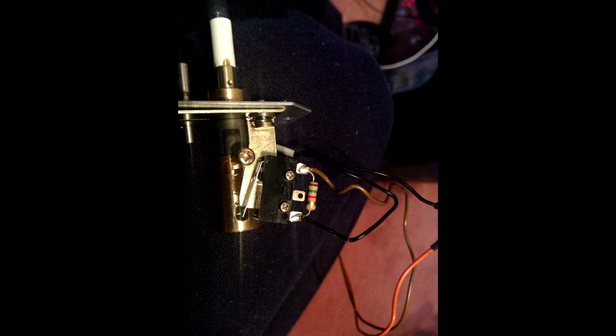Just at the top of the switch you'll see where the black cables are — there's some grey plastic around the cable. This is because there's a small hole where the wires feed through. When you're feeding the new wires through, be very careful that you don't start stripping the plastic casing from around the wire, otherwise you're going to cause a short connection. So when putting the new one in, be very careful. That's the old one — that's how it looked.